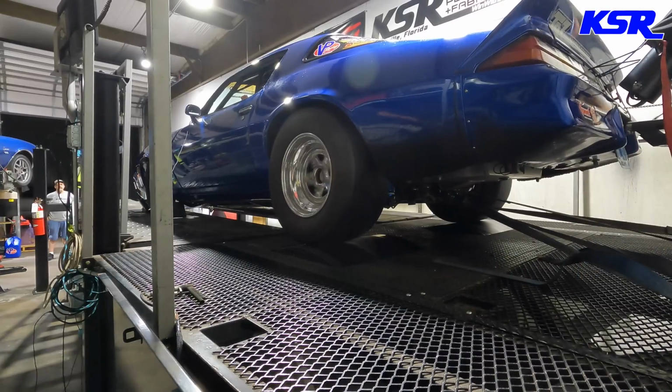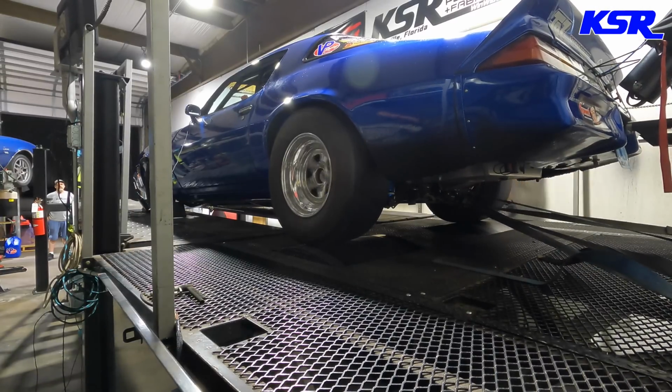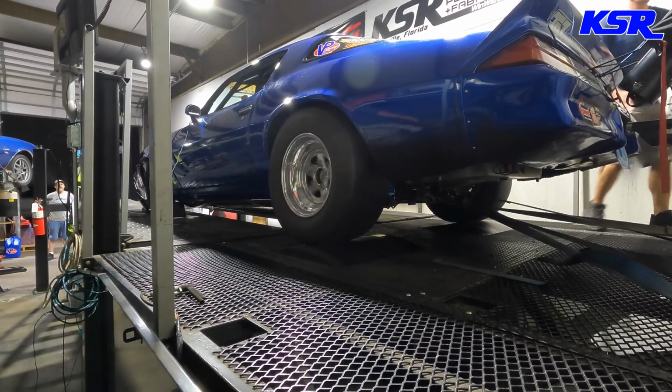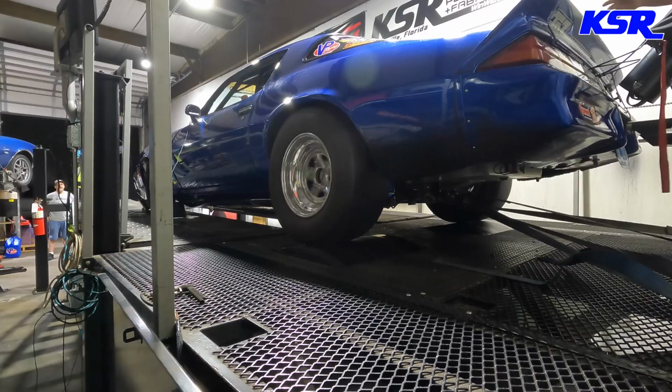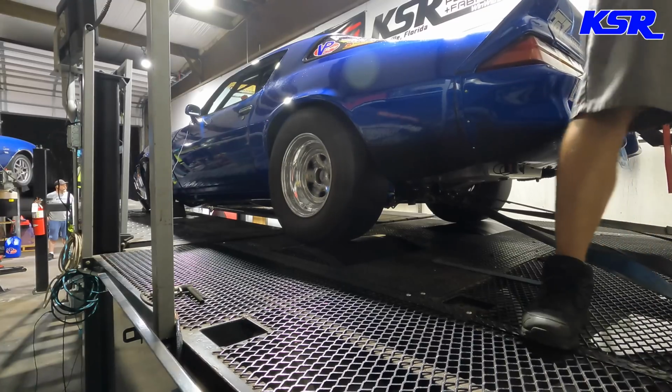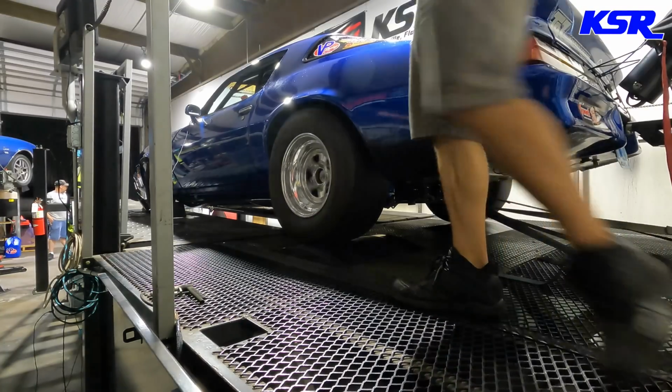They're different, so they're going to read differently and calculate the input differently, but one thing that I have been very happy with my DynoJet through the years is that it does seem to repeat very well with the cars that we continually tune on. Like lower powered road race stuff that we may put 50 dyno runs on a car, you can track your horsepower changes down consistently to a half a horsepower.